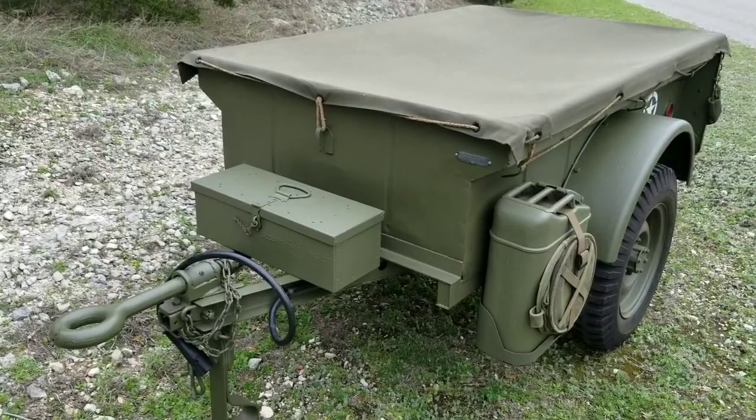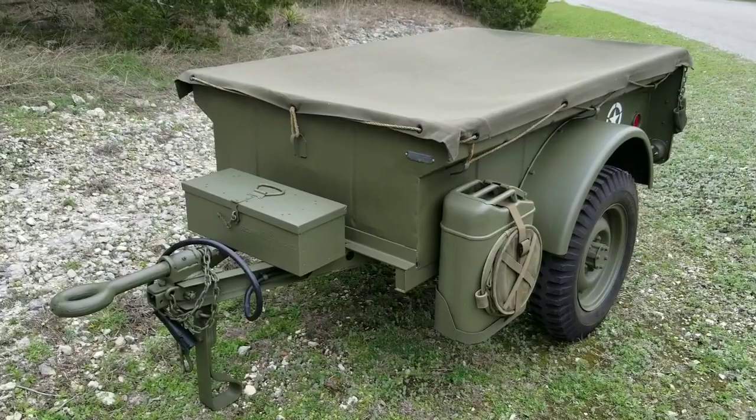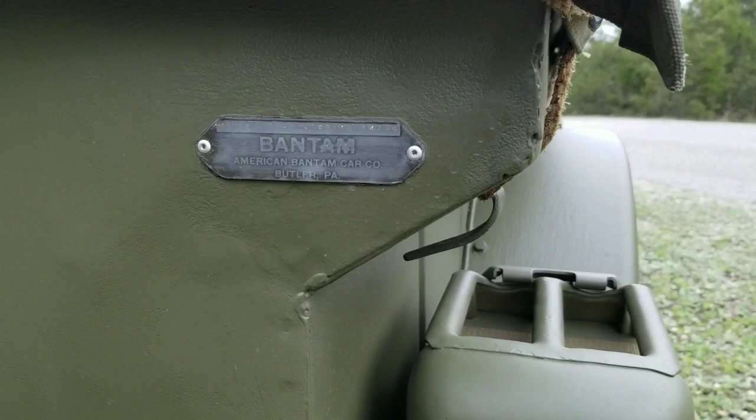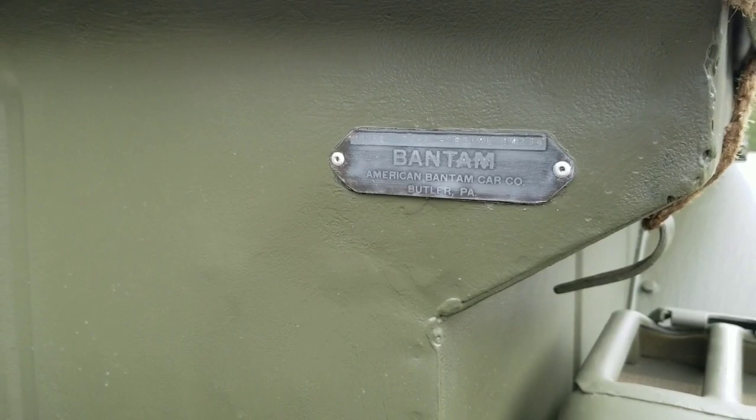So there's a quick walk-through of the T3C trailer. This one's been decorated to look military, and for people who don't know the difference it might have come straight out of World War II — but now you know. This is a 1947 model based on the serial number and the small civilian data plate right here, versus a larger data plate with four rivets that would correspond to the requirements of military data plates. This is the civilian version.